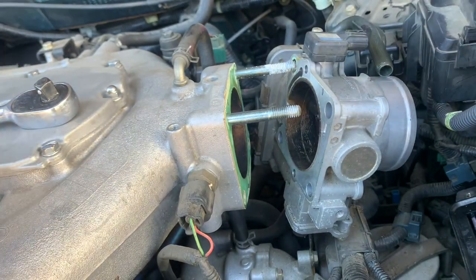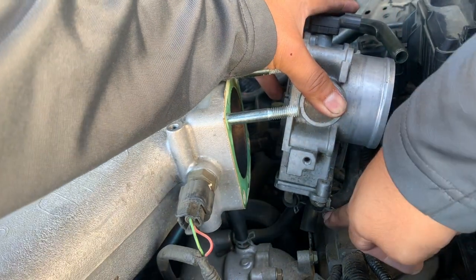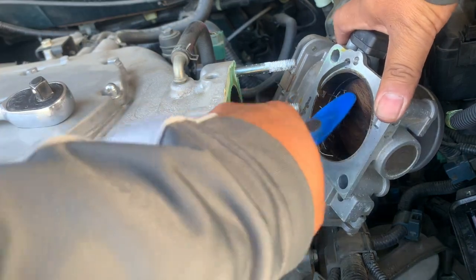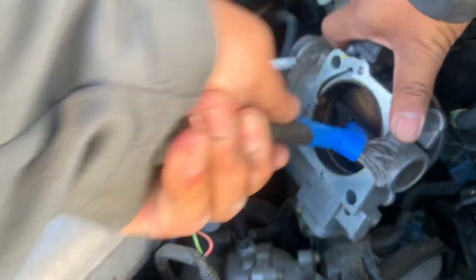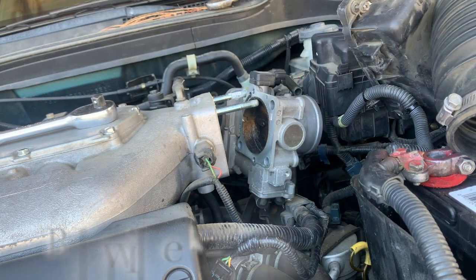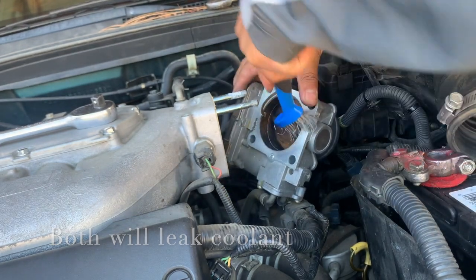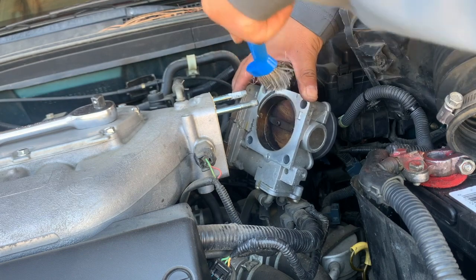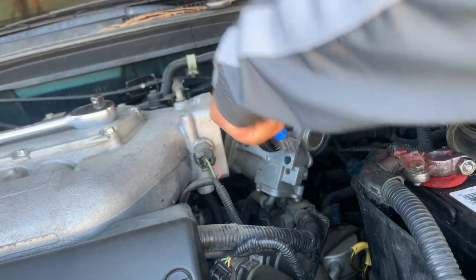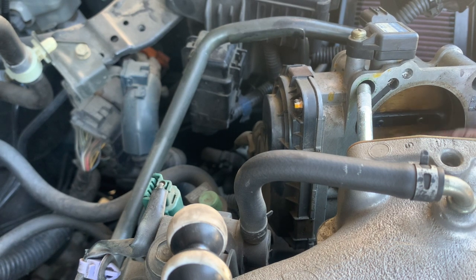You can just do this instead of removing the two hoses holding it back here — this one and this one. We have access to it, so why not just do this instead of doing the extra work? You are more than welcome to remove it, but one of those hoses will leak coolant — I believe it's going to be this one. We can avoid that. Go ahead and just clean it from back here. I just cleaned it with the brush for now, but I will spray this right now.